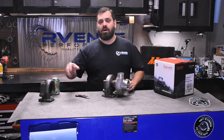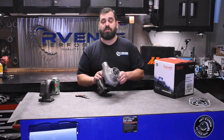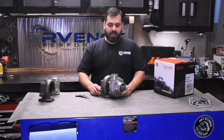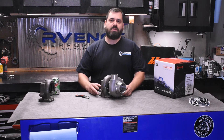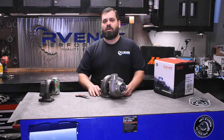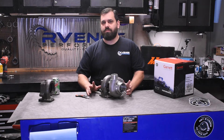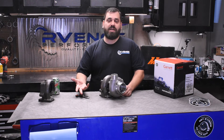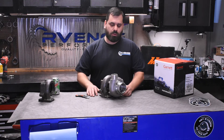The thing about automatics is turbocharger response is no longer quite as cut and dry because you can put a high stall torque converter in it. We have a Precision eight-bolt built torque converter designed to stall at about 4,200 RPM. Obviously, depending on engine torque and boost, that will change. We really just want to set up so that we can foot brake without nitrous and get the car off the line. Precision offers a free restall in the first two years, so we may have to do that, but that's just part of the game.